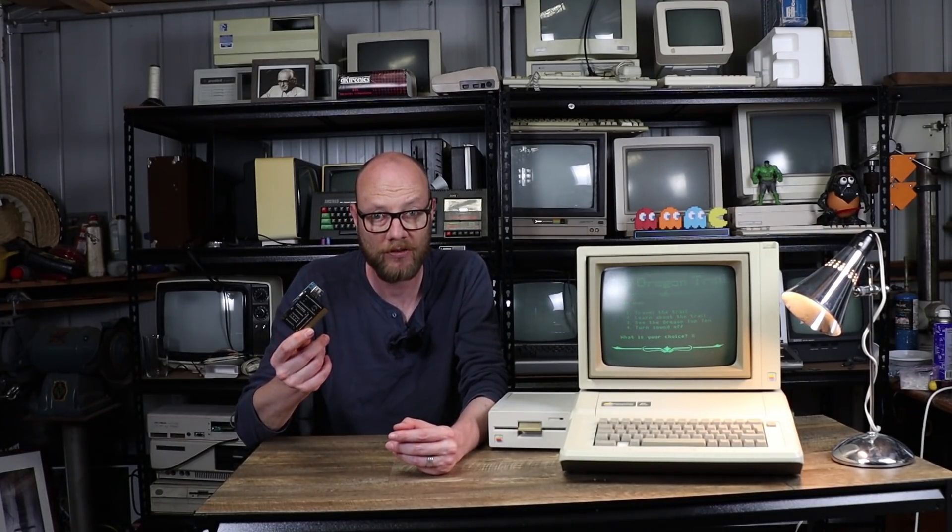This is not a floppy drive emulator, so it's not a replacement for the Floppy EMU. The best way to describe this would actually be a hard drive emulator. You load it up with ProDOS images — up to 32 meg if you're using it normally, and I think you can go bigger if you're using SmartPort images. You stick them on a USB thumb drive, and this just goes into the highest slot that you've got available to boot from, and off you go.